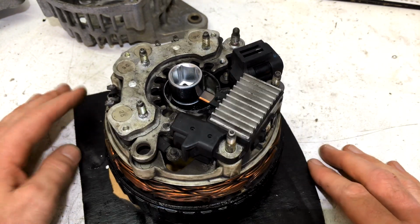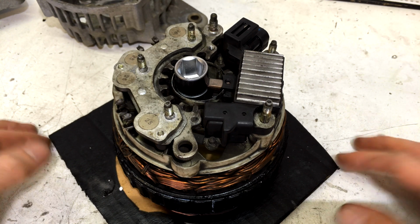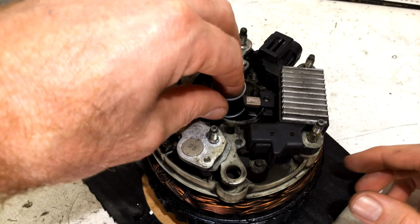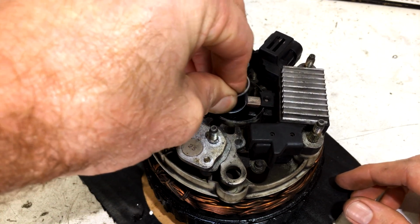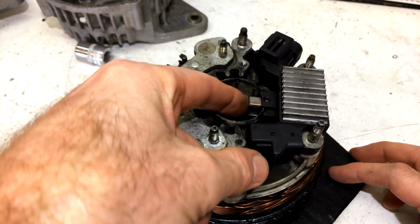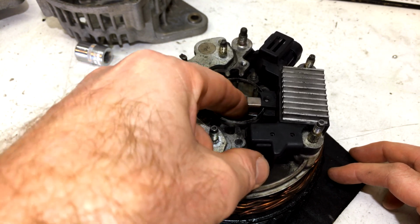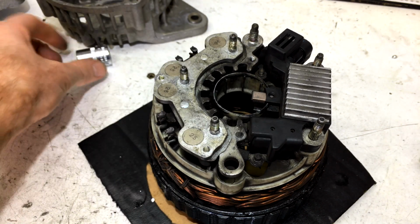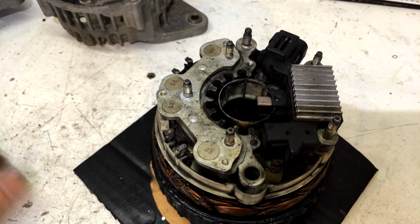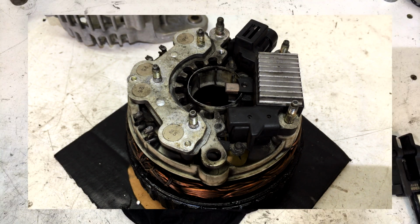Anyway, thankfully, we're just talking about alternator brushes, so you get the idea anyway. The brush is in there, okay, and we can just check it works, which it does. Beautiful. Compresses all the way in, flies out with tension, okay, looking good, nice. All right, so basically the back of our unit can go on now. So let's feed our armature up through our stator and we can start assembling the unit.